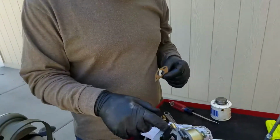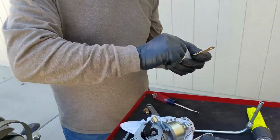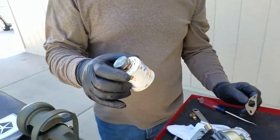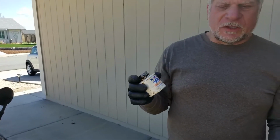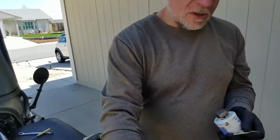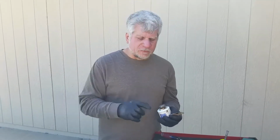Okay, gasket, sir. Now, there's all kinds of gasket sealers. Everybody has their own preference. What you using? I'm using the old standby, which is as old as the Jeep, if not older. This is the aviation form gasket, and it's a liquid, like the Teflon setup with a little brush inside. The good thing about this stuff is that when you want to take it apart, it won't harden. They make a number 1 version, which is usually in a tube, and that's the hardening kind. I've never used that, but I've taken things apart that it was used on, and it really is a pain in the butt scraping all that off. This stuff is a lot better for that, and it seals really well. The whole Jeep has been sealed with this.